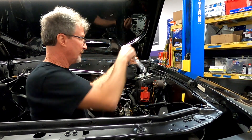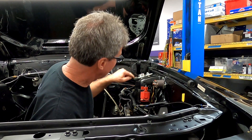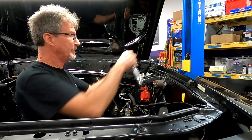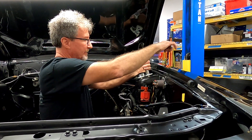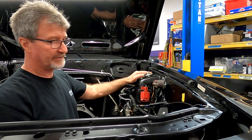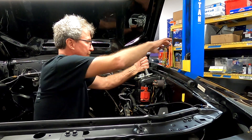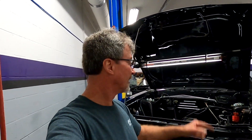I've got them in the middle for now. I'll go ahead and snug them up, because once I do that the washers will make an impression in the paint and that will allow me to put them right back where I want them when we do the final alignment. I'm not torquing them all the way down, but snugging them up so they don't move when I install the coilovers, to avoid scratching the paint.